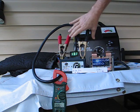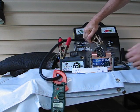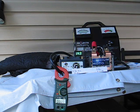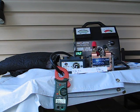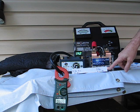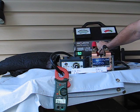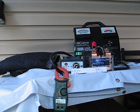What a surprise. Let's try the next battery. Okay, you can see that — fully charged, 14.3 on our LithiaMoto. Let's do the same thing, see what we get. This advertises 300 amps on the website. Let's go down to 9 volts. A little over 300 — if you catch that. Around 300 amps.